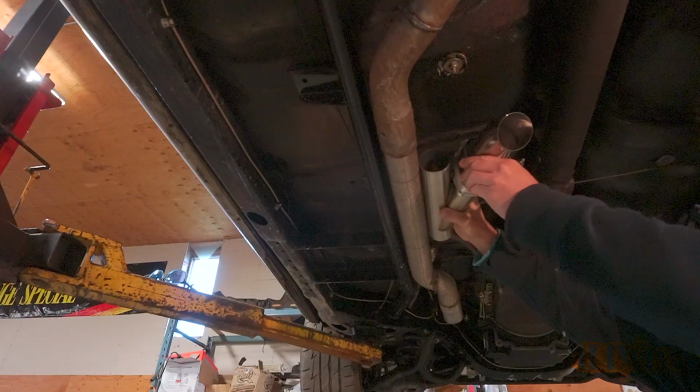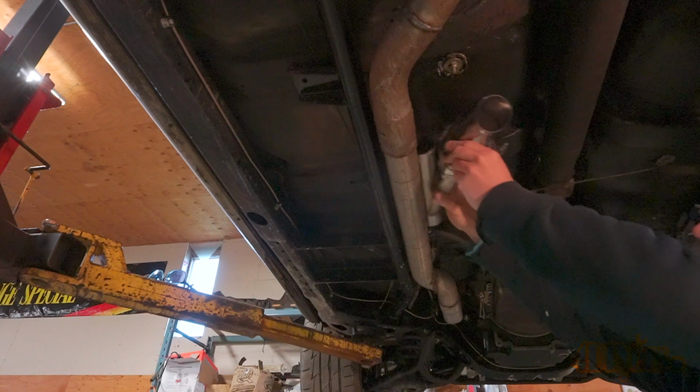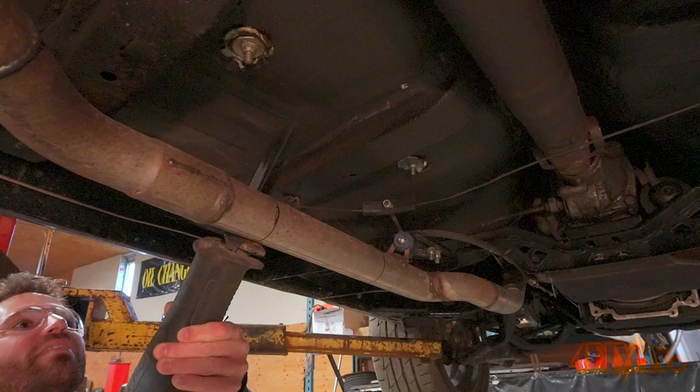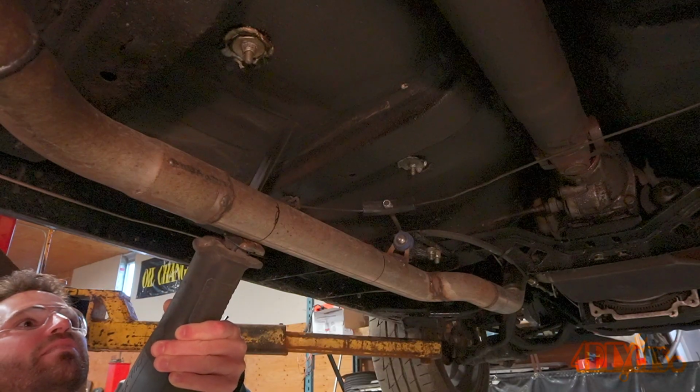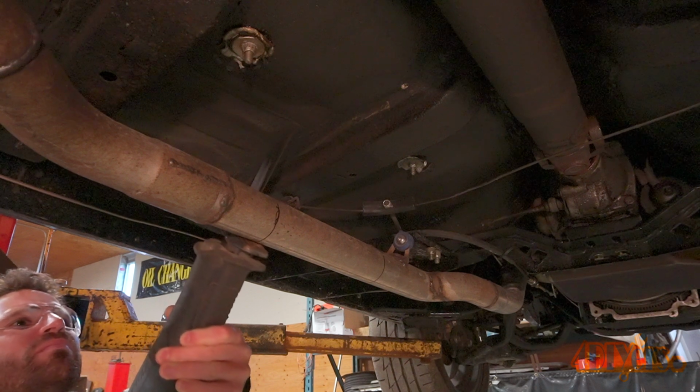It can be positioned both on the bottom and the side of the pipe to determine the fitment before fully committing to cutting the exhaust. The marks were made with a marker. You can run tape around the pipe or a gear clamp to help keep that line square with the pipe.